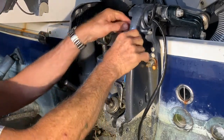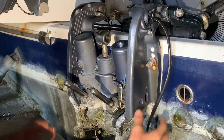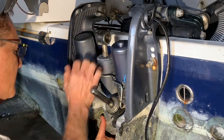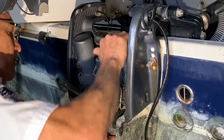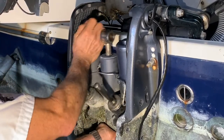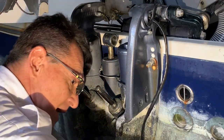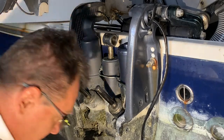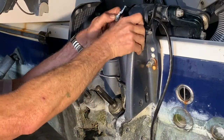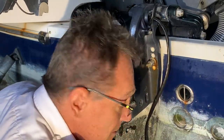Okay, now, it went good, but the holes for the bolts, remember, four bolts on each side, are not aligned yet. You have to align it. So I can see here it is not aligned. This side's gotta go back a little more. So I'm gonna go back outside, out again, and try to put it from the top. Go back, there you go. Now, I can see that the bolts align pretty well. I already have them here on the side with marine grease. So I'll go, after you put this through the bracket, remember. And then there is a holder right here. Use that holder too. And then I go one, two.